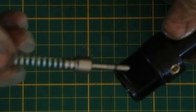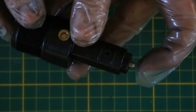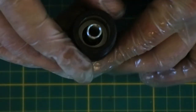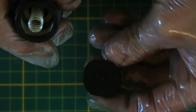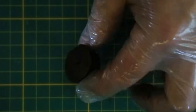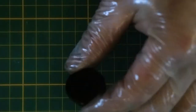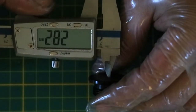Now we have to assemble the valve body as well. So we've got the valve spring, the valve stem. You slide that in, and it will exit. There it is. You've got the valve stem. Here's the spring. Now you have to put this one back to keep the tension on. What we can do is drill this one out as well, just to increase airflow. That's what I'm going to do now. I think at this moment it might be 2.8, 2.9 mil. I think we need to increase that as well. We'll do it all the same with the 4 mil now. Be right back.